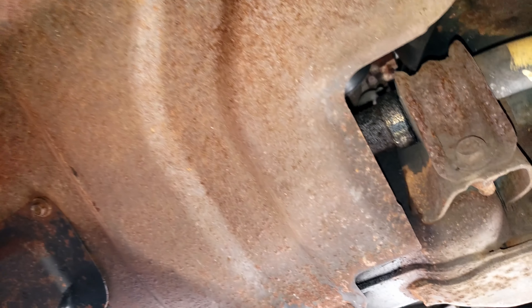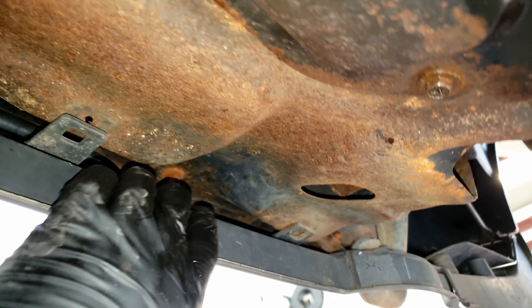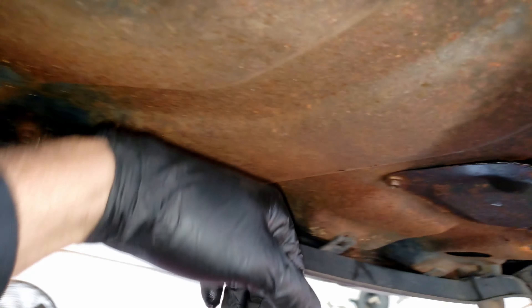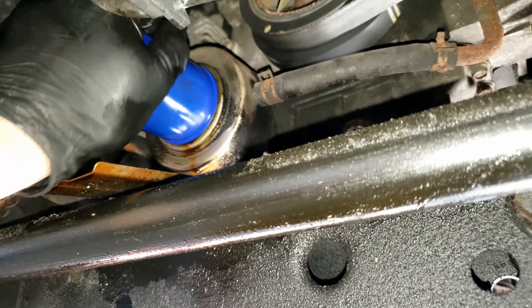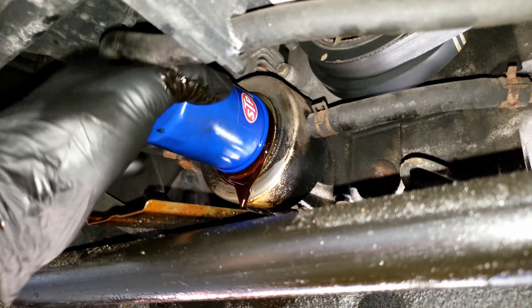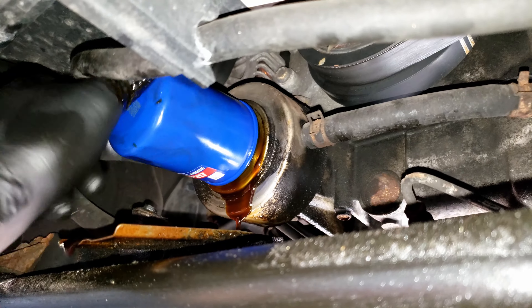On this cover you're going to have one, two, three up there, four — just looks like four bolts on the steel cover. Pop that down with those two covers down, put an oil pan under, and remove your oil filter.